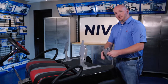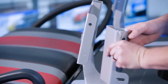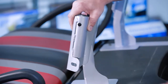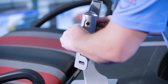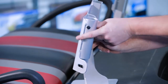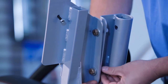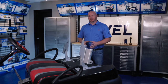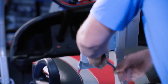Now we're going to attach the rear cage mounts to the rear main brackets at the two hole locations. On the cage mount, the angled tab with the slotted hole should be on the outside of the cart and pointed towards the back corner. We're going to use the 3/8 hardware, hand tightened only, and do the same thing on the passenger side. Once all four bolts are in place, tighten these bolts to about 90% — this will give us some wiggle room for installing the rest of the cage.